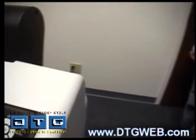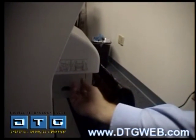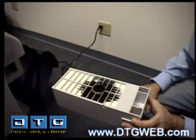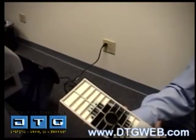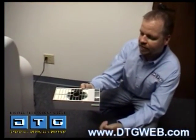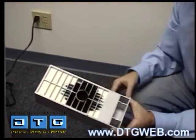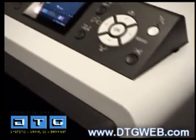On the 9900, the maintenance tanks are on both sides of the printer — right side and left side. You can simply pull one out and see the ink inside. As it fills up, the bar on the front panel gets lower, indicating less remaining capacity. When it completely fills up, dispose of it and replace it with a new tank. A useful tip: the right tank fills up much faster, so over time you can swap the left tank into the right side to get longer life before replacement. To reinsert, push until it stops and the front panel will confirm it's okay.